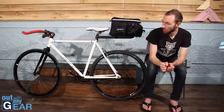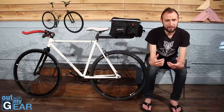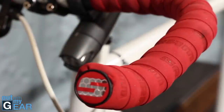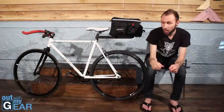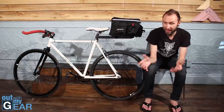Originally, this bicycle comes with BMX-style handlebars, which I thought would look pretty funny on this bike. So I swapped them out for the Origin 8 Bullhorn handlebars, which I really like. Unfortunately, these handlebars were a lot thicker than the stock ones, so I ended up having to get a new pair of hand brakes to accommodate the change — a little annoying, but it had to be done.